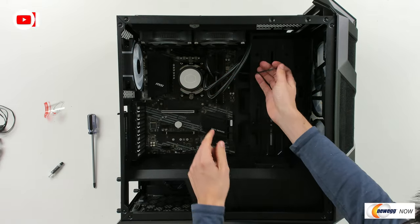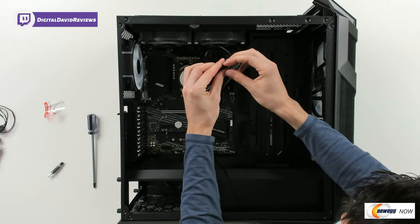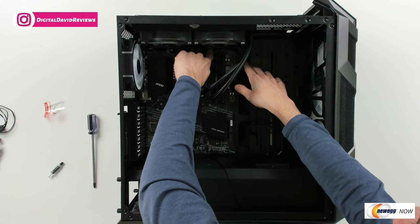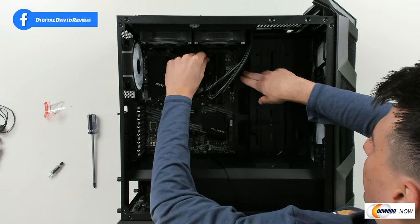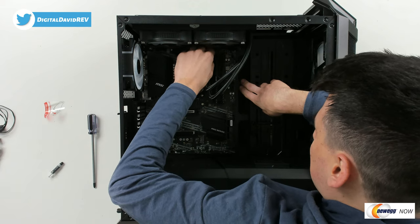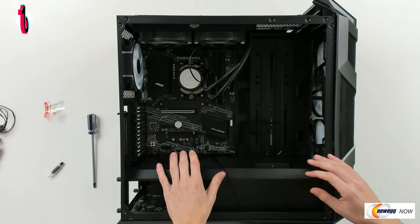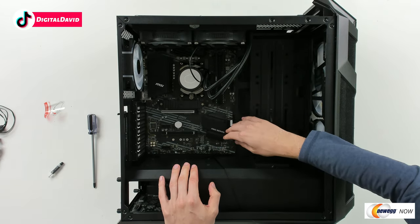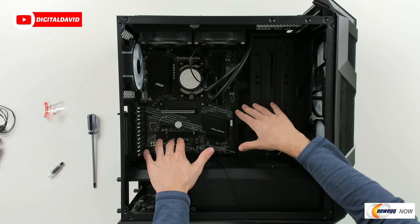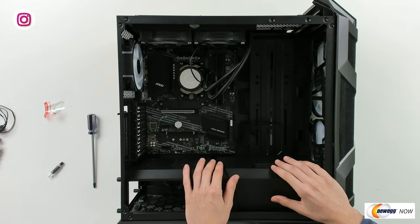That is tight as well. Now we can finish threading all of our cables through at this stage. So right here you can see we have our CPU fan cable. We actually have the CPU fan connection right under here. With my index finger under this fan, we're going to gently press it into place on the board, and then just slide it in and press down. We have it connected. And now at this stage I'm going to go ahead — we're going to tidy up a lot of the other cables from our I/O and our front panel header on the board before we get into our power supply unit. This will just help make everything a little bit smoother and easier for the rest of the installation so we're just not overwhelmed by wires.